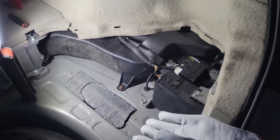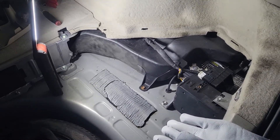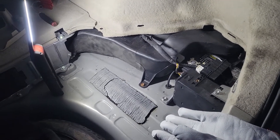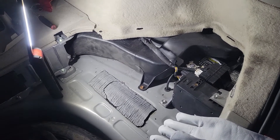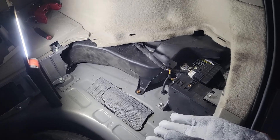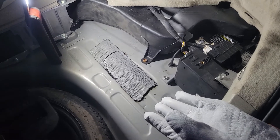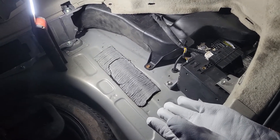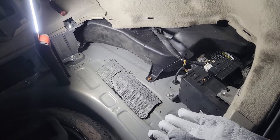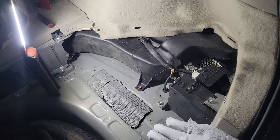The only reason I test drove this vehicle was to check where the isolation fault was happening. If I weren't getting any fault codes other than that 526 sub-code in the freeze frame data, I would basically have to take the cover off the inverter and start doing isolation testing up there. That can be really, really time consuming, and that's something where we'd have to charge the customer a lot of additional time. I charge one and a half times the labor rate on that stuff because hybrid work is just very dangerous and a lot more time consuming than typical testing.